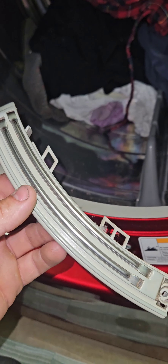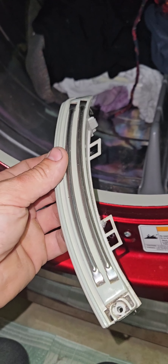That'll help your dryer dry your clothes all the way. And if you unscrew this screw you get the whole heat sensor out. Obviously you disconnect these — and this is your moisture sensor. So if your dryer's not drying all the way, you take this out and replace it.